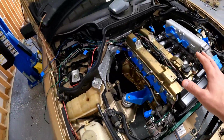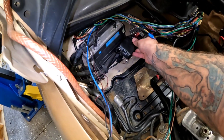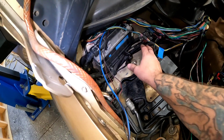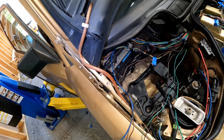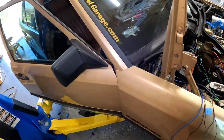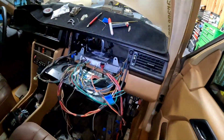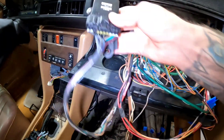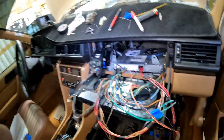I've routed everything back through here. You can see some of the Mercedes stuff — I'm going to eliminate these RPM relays. I plan on mounting my relay block right here behind the battery. This ECU is for the stock Mercedes ABS, and I've got everything routed through the firewall. I've put the ECU in the glove box and I'm going to make a mount to hold it in there nicely. I've got the stock igniter so if I ever have to replace it, it's just unplug and plug back in.